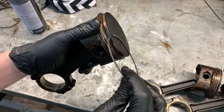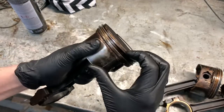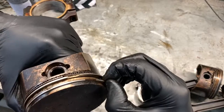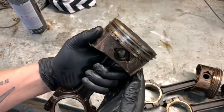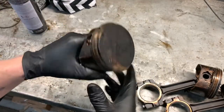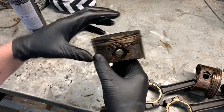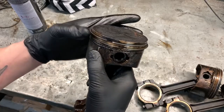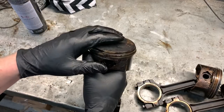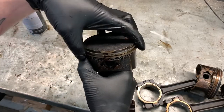Take your first compression ring, hook it into the ring land the same way. The closer you get to the top, the easier the rings are to put in — just pull it out a little, hook it in the groove, and you're done. That's the way that LS piston rings go on. This is true for 1999 to 2013 pistons for the LS engines, and it may carry over to other vehicles. Always look at your old rings when you take them off to see how they're situated, because that will be the same for your new rings.